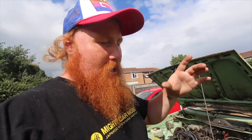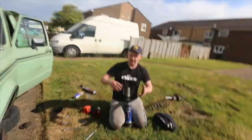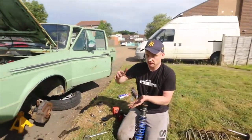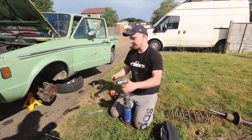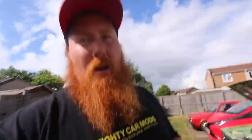For the rear, you can also get shortened dampers. If you're doing an axle flip you should get shortened dampers because the axle is closer, but since we're not doing an axle flip the dampers can stay at standard length. The drop plate method is a cheaper way to do it with no welding required.